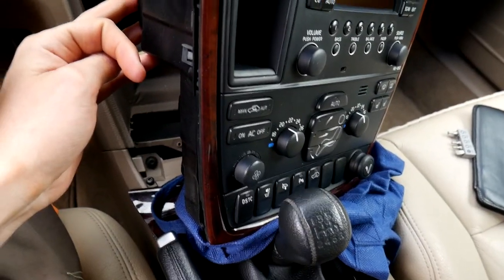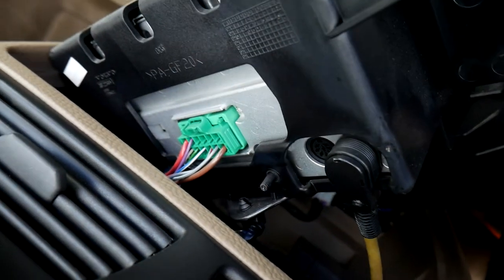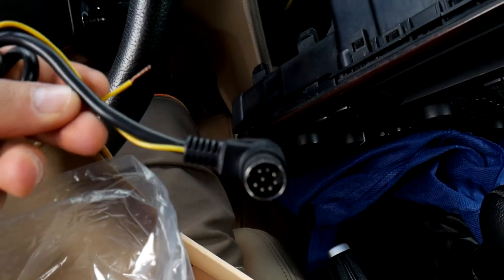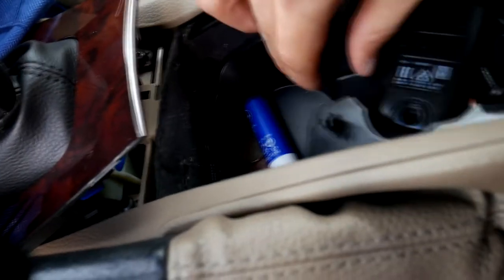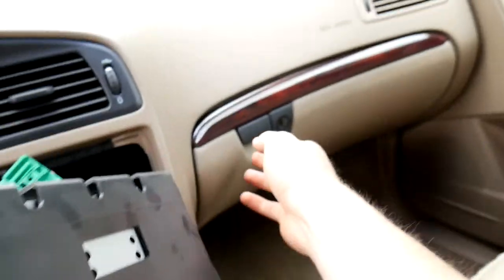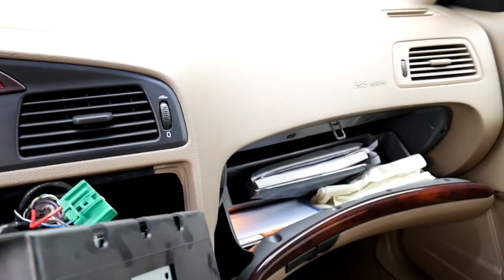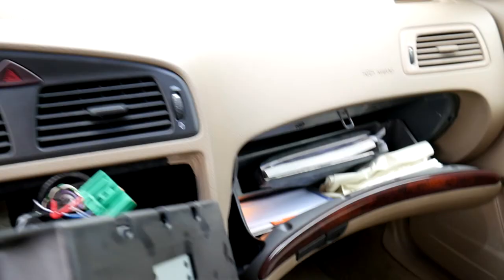On the back of the radio head unit, there is a free place for an external 10-CD changer — right here we will connect our AUX adapter. If the adapter is correct, the plug-in should match. Then find a place where you'll put this little box: in a cup holder, in free space behind the console, or in the glove compartment, which I chose for myself, because there is plenty of space and when inserting SD or USB memory, I can forget about this box.